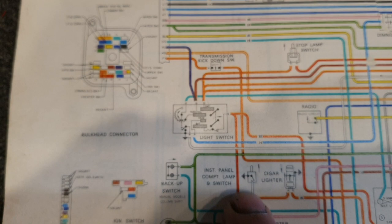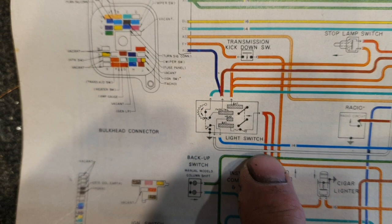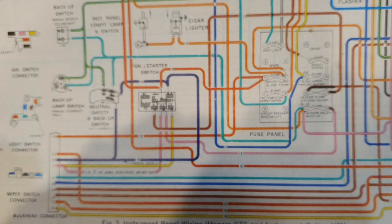Once that wire is cut and put into the battery side, there's a tail coming off there which is cut and just sitting there. That tail gets extended as it goes along and into the ammeter — so the G side, which is the gen side. I've cut it, there's a tail just hanging out here, and I've joined that straight into GEN. I hope that makes sense.